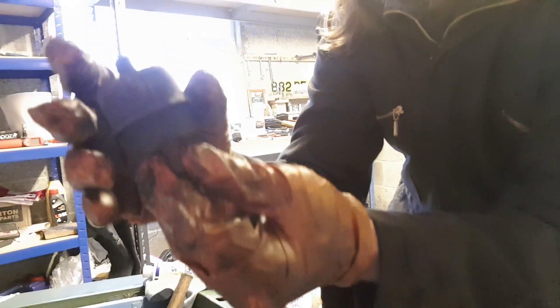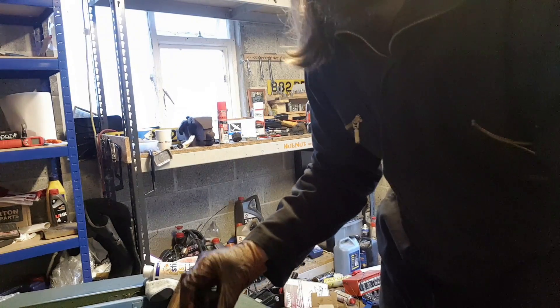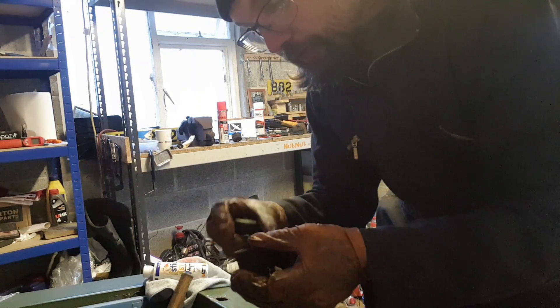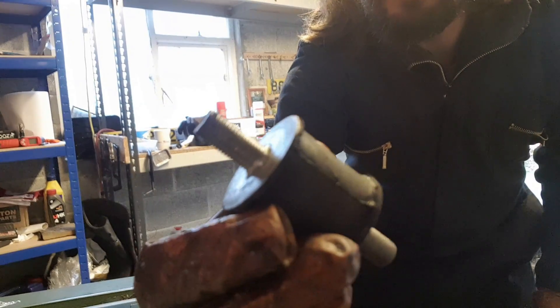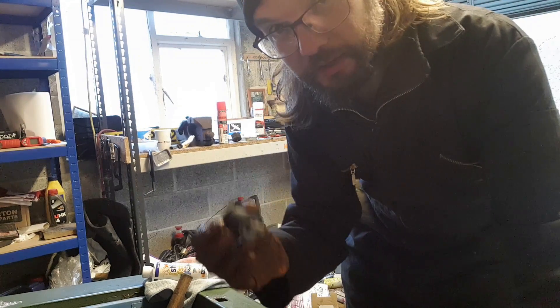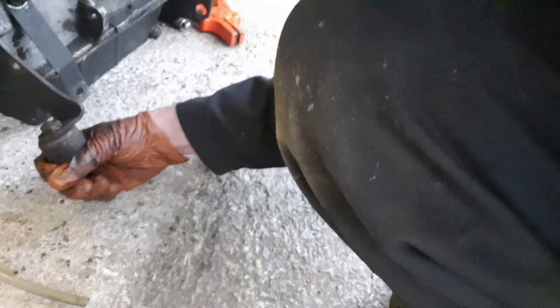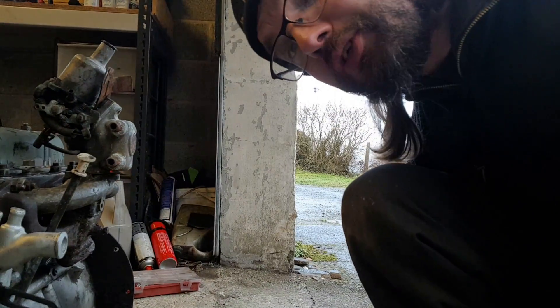So this is what the mount should look like — there's the rubber section that's just ripped off, and the mounts also have these little hats to protect them from the rocking of the engine. The mounts are bolted into the chassis first, and then we drop the engine in and the holes go through onto the mounts. We've got new mounts, so we'll keep that as a spare but I will need the hats. There's a brand new mount — it was on the roof of the Fox right in front of me. The other one was finger tight, this one not so much, so applying some penetrating fluid — or as they call it in Scotland, remonstrating fluid. I like that.